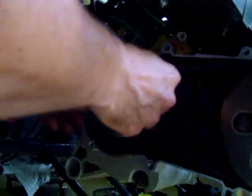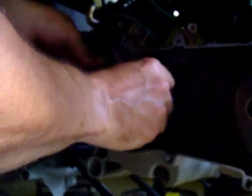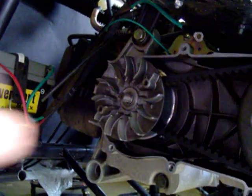There's half of our variator. Let's put the belt on there — you have to ride it up there. We'll get the front part of the variator assembly — notice how it's splined as well. Stick it on there, and we've got a large thick washer and our nut. As you start tightening this up it's actually going to collapse some — that's just the belt being put into position. You'll feel like it's just threading on easily; it's just the belt shifting into proper position.